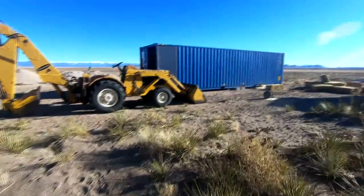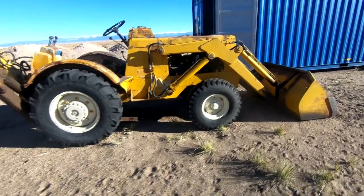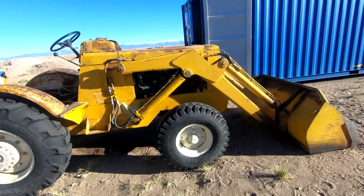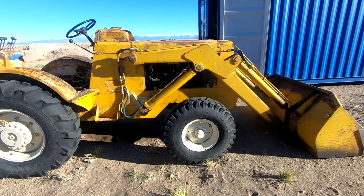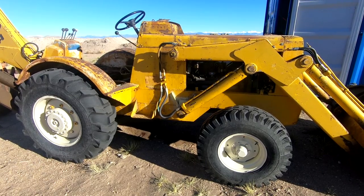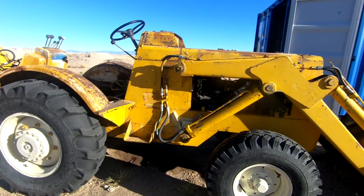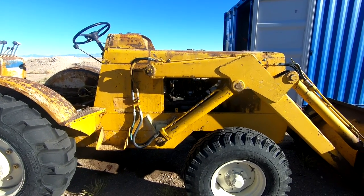In the meantime, with the bit of light we've got left today, I might be able to jump on to Dyna here for a few minutes. We've got a brand new engine, brand new ignition system, brand new batteries, and when we first got it going last year everything was doing great. Now we've developed leaks all over the place, and the transmission — if you guys have been following — has problems and needs to be rebuilt. That'll be a winter project. But I have another issue: I switched the ground wire, got a new ground wire for the battery because the other one was too small, and then switched a couple of wires around when I was working on gauges, and somehow I've lost ground.